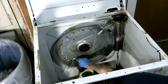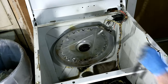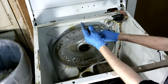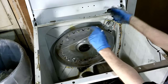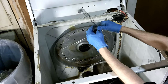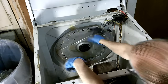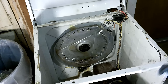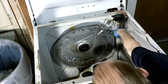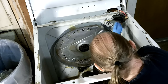It broke — right there where I was saying it looked burnt. It's been heated so many years that the whole thing is just ruined, it's that brittle. The temper is ruined in most of it. You can buy this type of wire in pieces of two to ten feet, but it's really fiddly getting it on there. I think it's probably worth it just to get the whole heating element assembly — take it off, it's got screws in from the back, use a quarter-inch nut driver, and put the new one on.